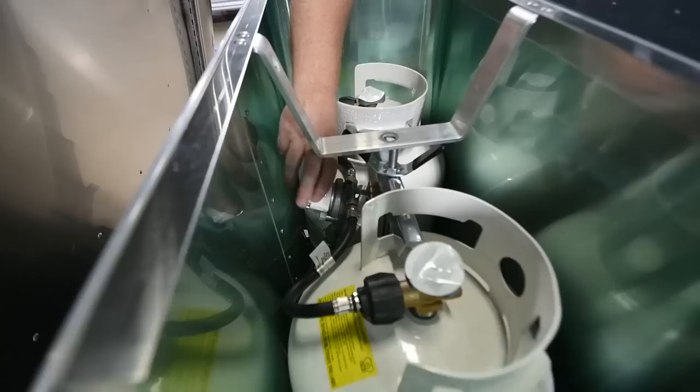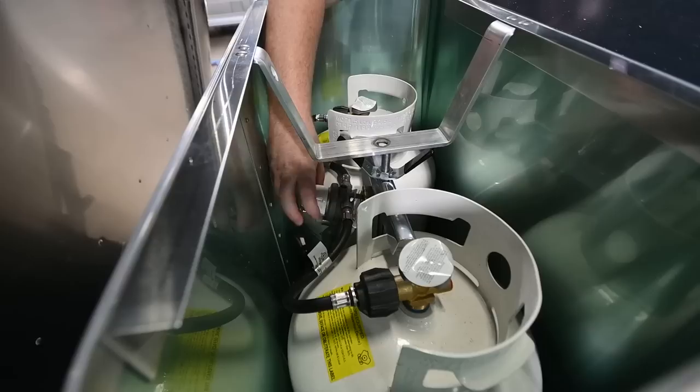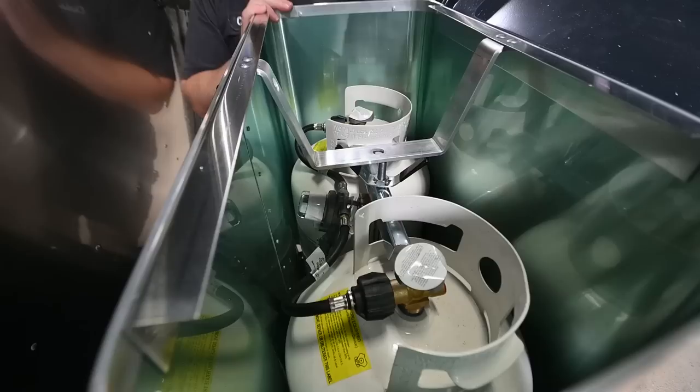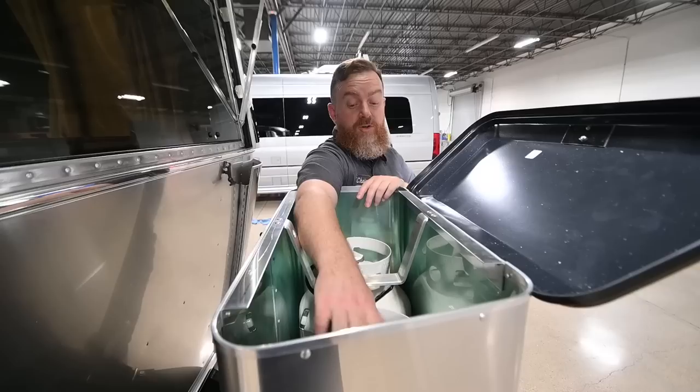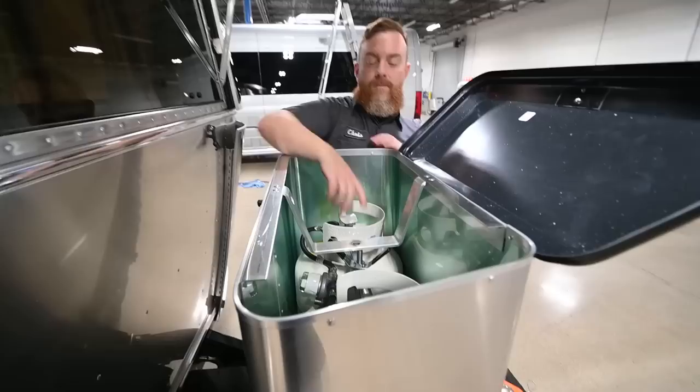You've got your propane bottles under this cover. This trailer comes with 30-pound bottles already full. In between, there's an automatic regulator — if you've got both bottles open, when one runs empty it'll automatically switch over to the other internally. You can use the little post to point at one bottle or another. This trailer does not come with a gauge for propane, so I recommend running one bottle open and one closed. When that open bottle runs empty, whatever device you're using stops working and you come outside, close that bottle, and open the other — that way you know you're on the second bottle and can be more conservative.